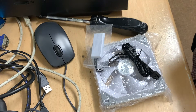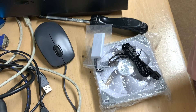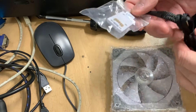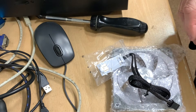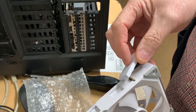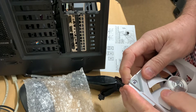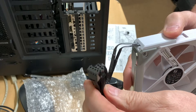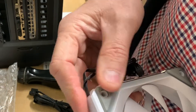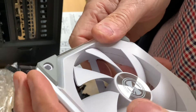The liquid cooling is now all done. The customer wants these Lian Li RGB fans installing, which seem to have quite a lot of wiring — separate little modules that connect to the fan, which I've never seen before, plus a central hub. The pins here go into the slot and slide in — that's how it locks in. Each fan has two wires that need to be connected to the central hub. This is the third fan — make sure it really clicks into place.